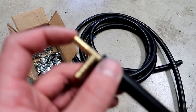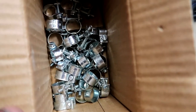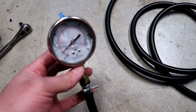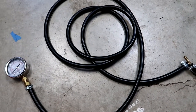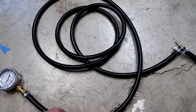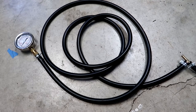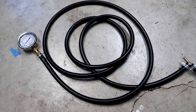This piece will go to your degas bottle, and this will hook into the hose that used to go into the degas bottle. And then an assortment of clamps to clamp everything together. Here it is, all completed and clamped up. This whole setup cost me about $35 to $40 just piecing together all these parts. When I was looking for this, I actually found a listing on eBay for about $50 for the whole thing already put together. So that's one option, but if you want to save a few bucks, it's not too difficult to put it all together yourself.